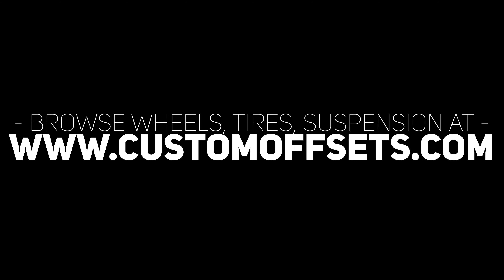The rear has similar parts with a little different stuff. We got the new sway bar end links for the rear, just like up front. The new Falcon shocks for the rear — these ones have the roost guards installed, to shield the shaft when you're driving and kicking up debris. Got the new bump stops on top and the new mounting pads on the bottom, spaced appropriately according to TeraFlex's requirements. And then we got the new coil springs in the rear.